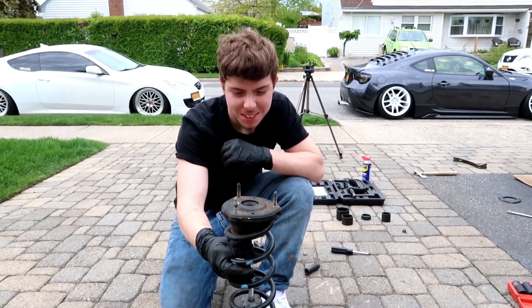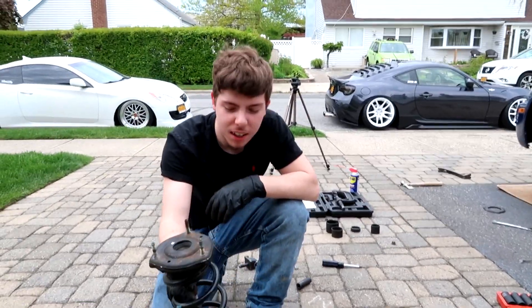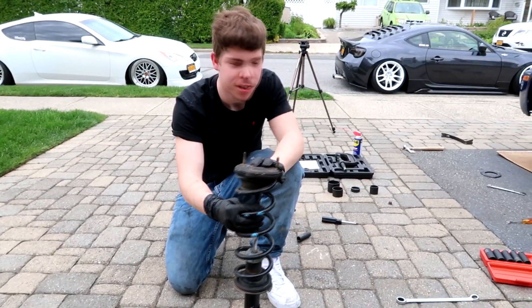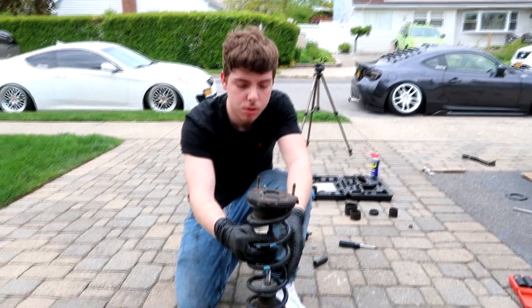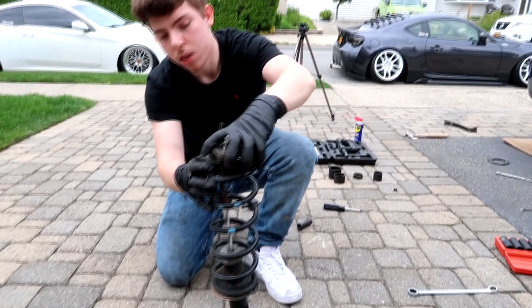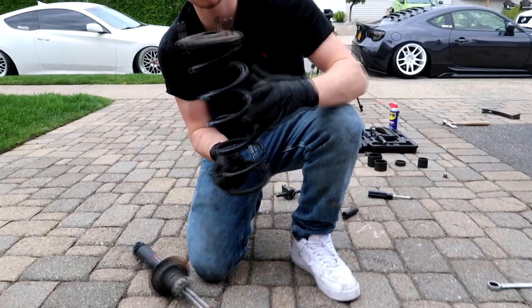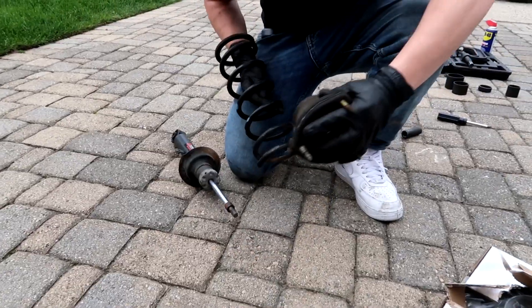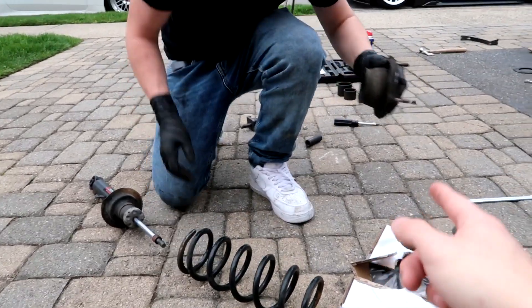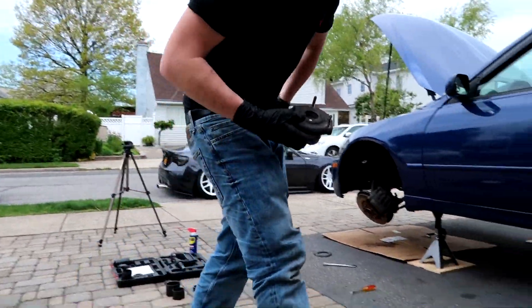So here we got Ryan — he's making his AC Auto debut. Alright guys, so we just finished taking out the front driver side strut. We just took off the spring compressors. This is going to be seated into the spring — once I took the spring off, I honestly just shoved my arm in here and pushed out the boot so you're able to get it out. We're reusing the top hat on the new coil because I cheaped out on my coilovers.